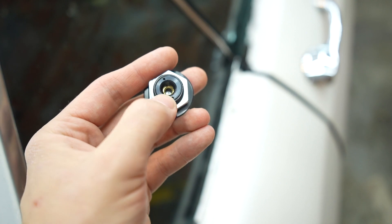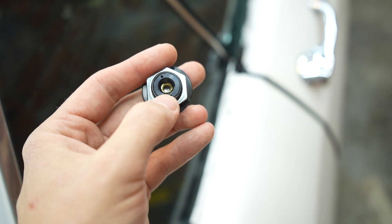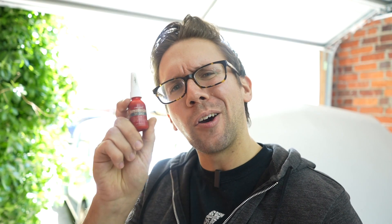Go ahead and spin the nuts out, clean all the assembly grease off those threads — you don't want this part coming undone. You do need grease in there for the button so it doesn't get stuck, but then lock it down with some thread locker and tighten it down properly. Now that you've got your quick latches actually assembled correctly, we're going to build some brackets.